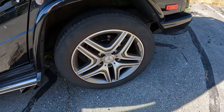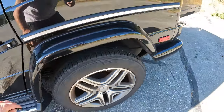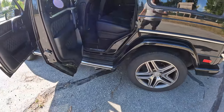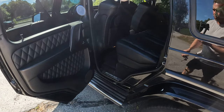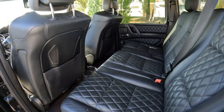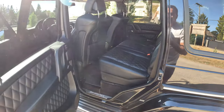The brakes I'm assuming are worn out — that's why we've had that brake pad wear warning. The Launch scan told me it was the rear brake pad sensor that's failed, and I'm assuming it failed because it came in contact with the rotor.